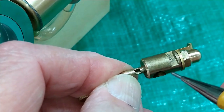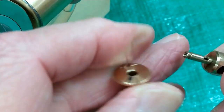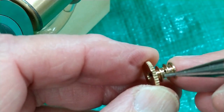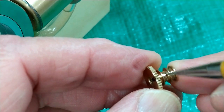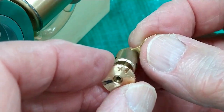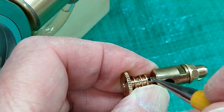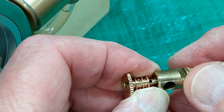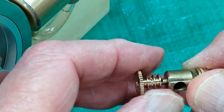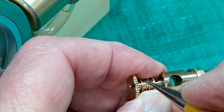The slot machined in here is parallel to this and at right angles to the opening in the barrel. Looking at this piece, a hole is drilled in here and then there's a slot cut across it — I've marked that with a notch on the disc. When this was received, it was turned to about this position, which puts that hole right at the corner of this slot. At full throttle, it's opening up that hole to the needle valve for fuel. In my opinion, this disc should remain stationary and not wiggle around — when the barrel turns, it's shutting off that hole, but the slot remains open.